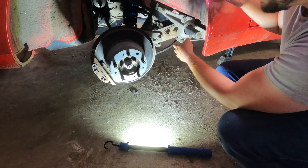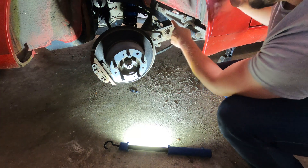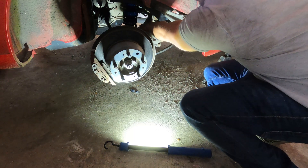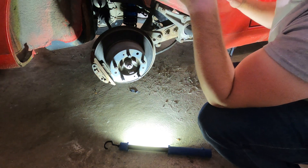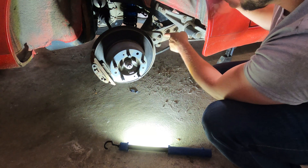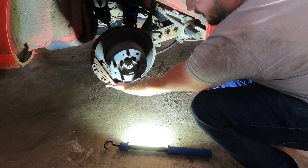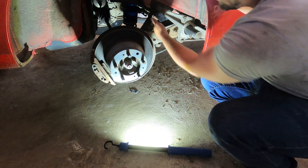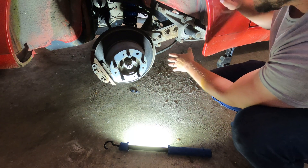From there, things start to get wild. There are a bunch of 19mm bolts, and you're going to want to wrap and suspend the entire rear trailing arm — basically a rear control arm — up above. There's a big body support that goes across; I just used rope and suspended it from there. You're also going to want to disconnect the brake line and the brake sensor on the left side, and the brake line section up above. Those are about 13 or 14mm, but the special tools you really need are coming up next.